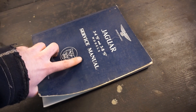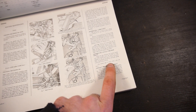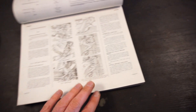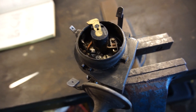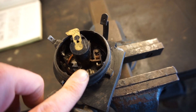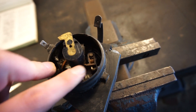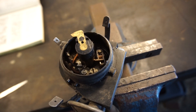I have the workshop or service manual here for the car that this distributor came out of - 1966 S-Type. Under engine, routine maintenance, right down here it says how to set the gap. The gap should be 14 thousandths to 16 thousandths of an inch, which is 0.36 to 0.41 millimeters. It says where you're supposed to lubricate it. It differs from car to car how often you're expected to do this - usually it's once a year. When you have your yearly major service, you would clean the points, or more often than not just replace them. These are so, so cheap - still really, really cheap. I would not clean this if I was putting it back in the car; I would take these out, put in new ones, because they're just dirt cheap. Your old set that still works, you can keep as a spare in the glove box.